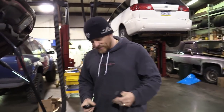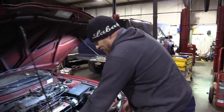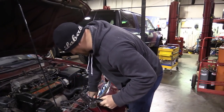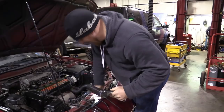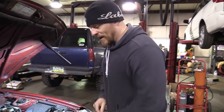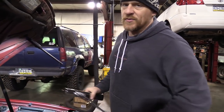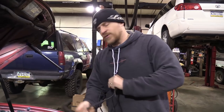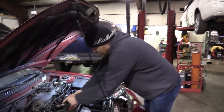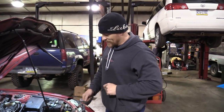The TE1 and the E1 — the reason I would know that is working on a lot of pre-OBD2 Toyotas back in the day. Those were the same two pins you jump to get flash codes out of the system. You jump those two pins together, turn the key on, the check engine light flashes at you, and you count the number — that's your code. You guys working on only today's cars have no idea how good you have it; it was much more challenging in the early days.